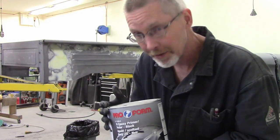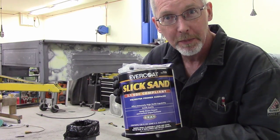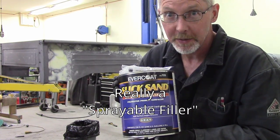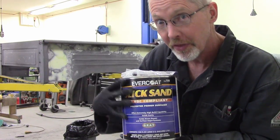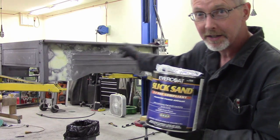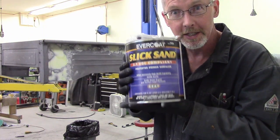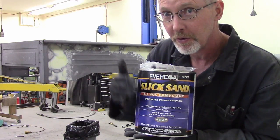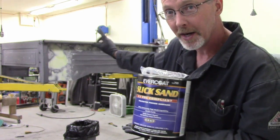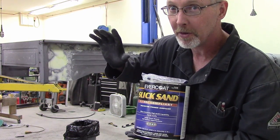I'm going to put the epoxy back on over top of the filler that I've done, just so we have a sealed, epoxied surface. Then the next day I'm going to add this stuff — it's a high-build 2K two-part primer. In theory, this builds high enough and then I can sand the thickness of this to get rid of any imperfections in the bed and the fenders, and eventually the whole rest of the cab. Because with this, if I sand through and then touch the epoxy, I can stop — whereas when I sand through the epoxy I have to re-epoxy the thing. So this is making a bit more sense.